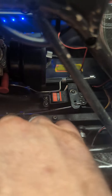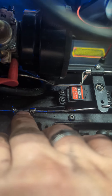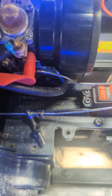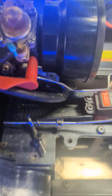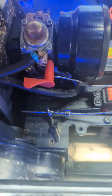When you go full brake, you want this to compress and be completely compressed at full stroke. It's full compressed and you can see where it's putting pressure on your brake. But when you give it throttle, you don't want anything in the back pushing your brake forward because it'll lock it up.